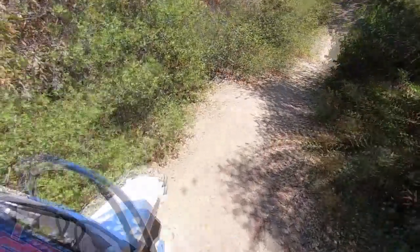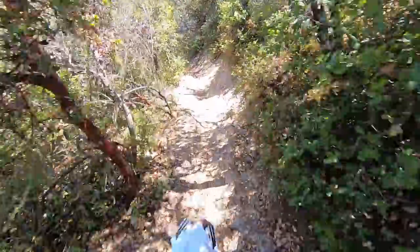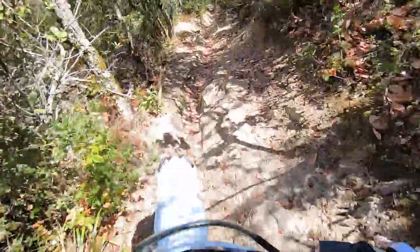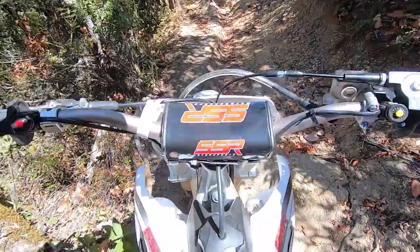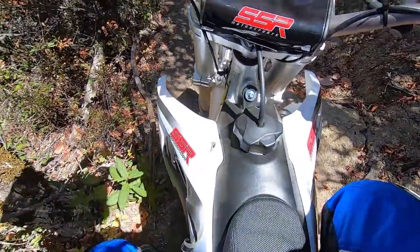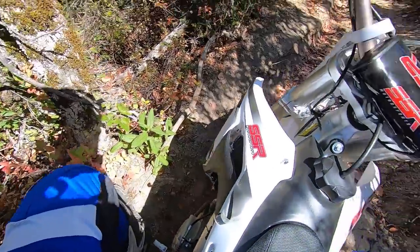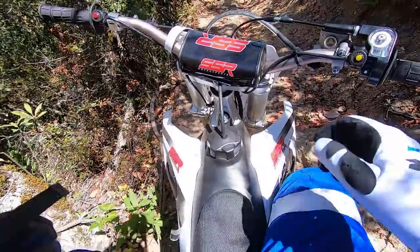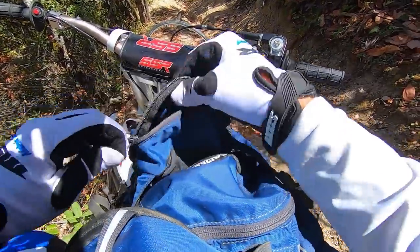And there's a stall due to my carburation. Dude, this is awesome. All right, our carburation's a little off. We keep flaming out here. That's okay. I'm going to probably mess with that air fuel screw a little bit. Man, that fan's doing its job right now. Guys, this bike kicks ass, seriously.